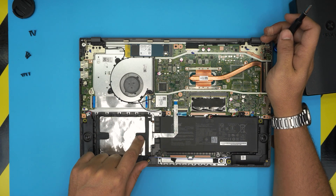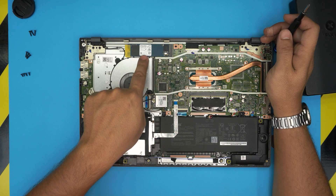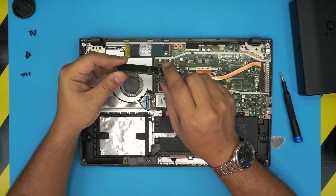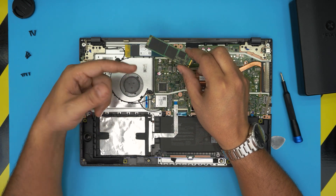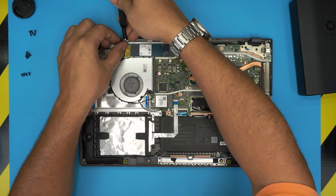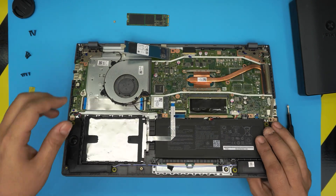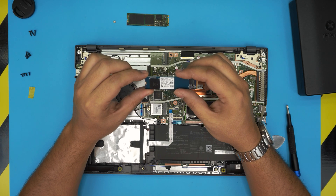Down here you'll see the mechanical hard drive connected via a flex cable, and the M.2 PCIe NVMe drive right here — this is a low-quality Western Digital NVMe SSD, which means it won't last as long. If you want a good replacement, grab a Samsung brand, which uses more NAND chips and increases the lifespan. To remove the NVMe drive, remove the sticker tape on top, then remove that tiny screw. You do not need to remove the battery for this process at all. Once unscrewed, it will pop up at a 45-degree angle — pull it back in that same direction.